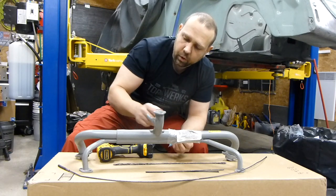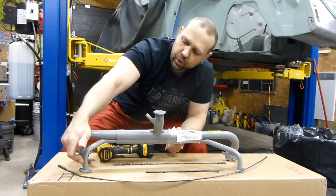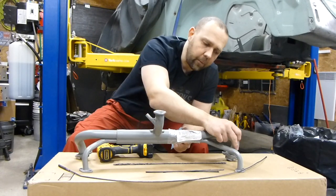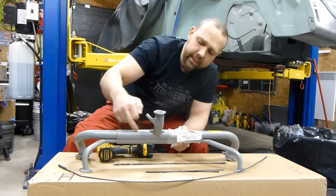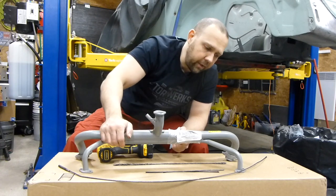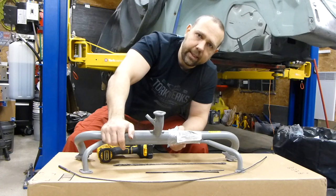Now, the process: once you've unmounted your muffler, you want to check with some compressed air if you can blow air up one side and feel air coming out the other side — there should be no restrictions in the flow. If you have some air coming through but very weak, it means it's starting to close up, kind of like a clogged artery. If you have free-flowing air, you don't have any issues. If you have no air coming through, then you're guaranteed it's clogged up.